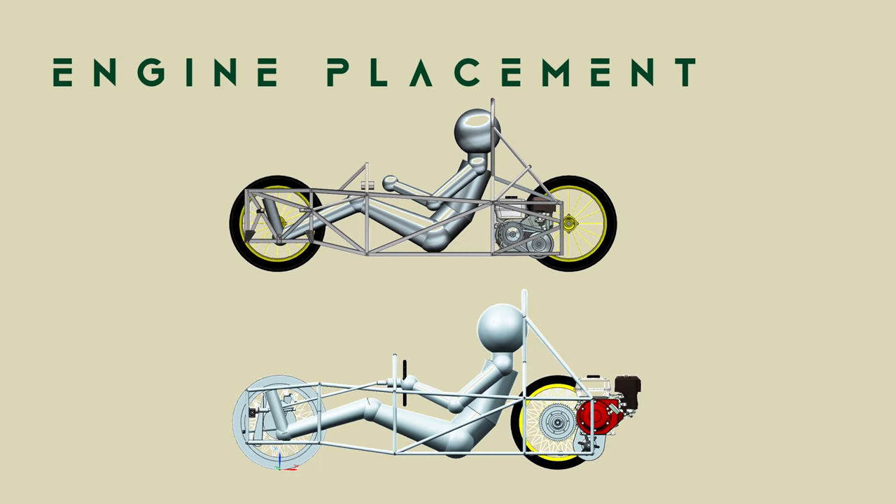To summarise: trail gives self-centering force and feedback. The steering moment increases proportionally to increased force or trail length. More moment equates to more feedback into the steering wheel — but it's a balance. Too much and the steering becomes too heavy; too little and you lose feedback. As a side note, the distance from the tie rod to the steering axis will also change the force back into the steering wheel but it's not usually a tool you can play with for Ackermann reasons.